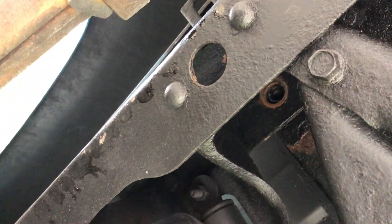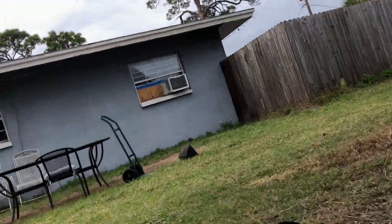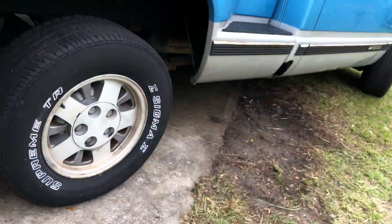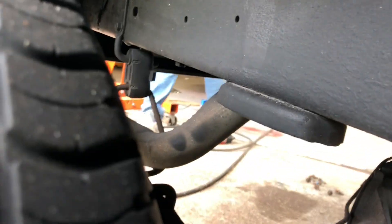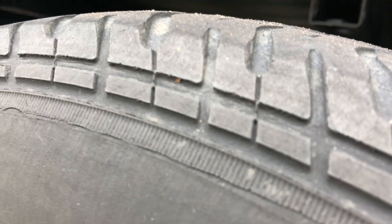There's one on the other side, and one or two more at the front. This one back here, and this one back here. I already unplugged my wires. And then there's two more up here — there's another one here with an opening. Then there's one all the way back here which is on the outside of the frame, not on the inside like the rest. Don't miss that one. Eight bolts total, plus that ground bolt.